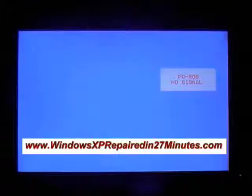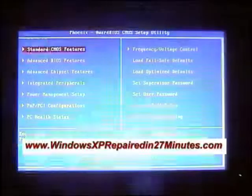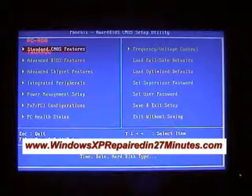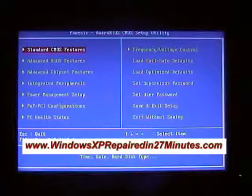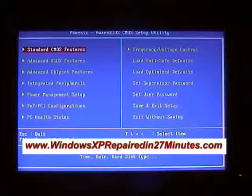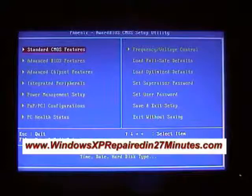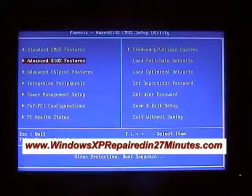I'm now at the broken computer. Start the computer up, and when the black screen appears, look at the bottom of the screen — press Delete to enter setup. Tap the Delete key repeatedly and the BIOS window will appear. Before doing anything else, open the CD drive and insert the CD-ROM. Use the up and down arrow keys to navigate the options.